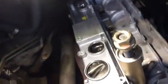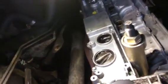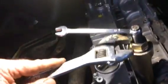And you'll see one of the reasons why I like this little device is that you don't have to break into a sweat. It's actually got a lovely little bearing just there at the top. So the only friction you really feel when you're winding down on this nut is hopefully the friction of the injector departing from its socket inside the engine, whipping away from all the carbon deposits. I think it's a 10mm spanner possibly on the top. If you just anchor the top with a spanner and then get a wrench on the nut, you can wind the nut down, and if you're lucky, the injector will just slide up into the little extractor.